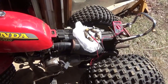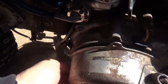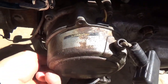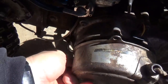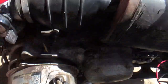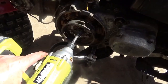With that caution, let's get busy. First thing we've got to do is get the recoil off. I've already loosened these guys. I left the cover off the points just so I could go through everything properly. By the way, this stator happens to be in really nice shape — it has the connectors and everything on it, and the wires don't look too crispy, so that's all good stuff.